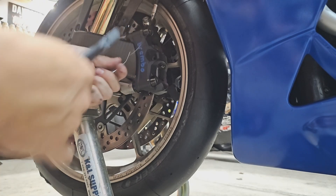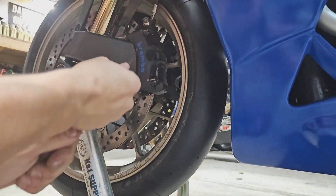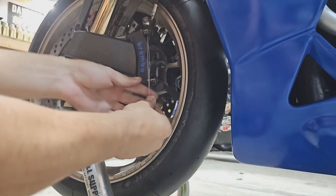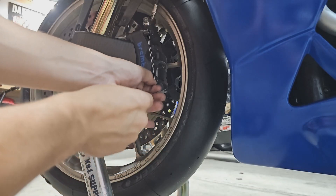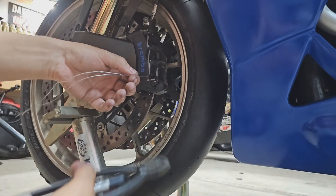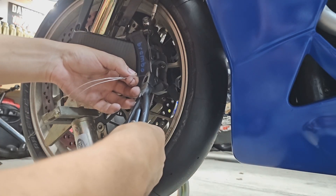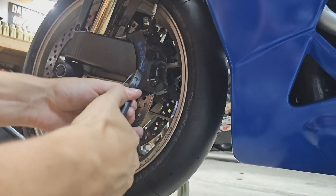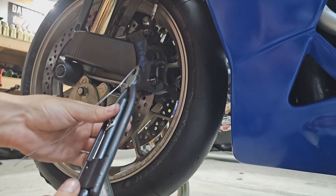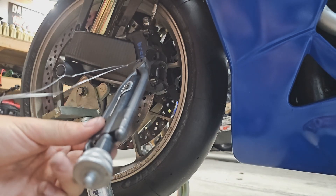If you have plenty of wire, you don't have to worry about being perfect. Once we're about lined up, we're going to make sure this is relatively straightened out and bring it all the way down to our hole. I'm actually just going to put a bend in it right there. At that bend, I know that's my mark for where I'm going to clamp my safety wires and start my twist. So you want to twist it in between. Take your safety wires, clamp them on there, pull the lock down — the lock is just this guy right here. You pull it down and it locks it clamped. And then we start our twisting.